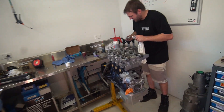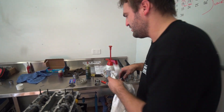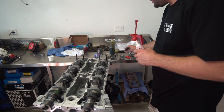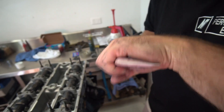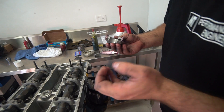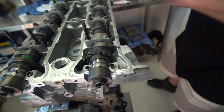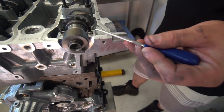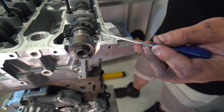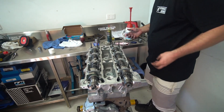You put a little bit of this 515, which is a flange sealant. Because these are mounted flat on a machined surface, you use 515 — it's for really tight tolerances. You do it just on the outside of this cap, along these surfaces. As that goes on, it seals just there. If you don't do it, oil can track underneath the gasket along under the cap. So people think it's the camshaft seals — there's nothing wrong with them; brand new camshaft seals and they're still leaking.